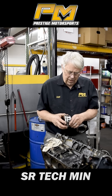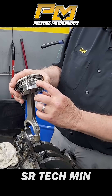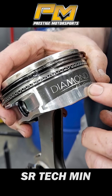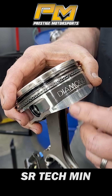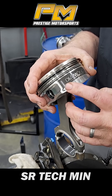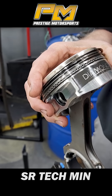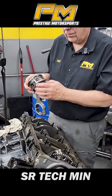I just wanted to point out, as I'm tearing it down, you can see this scuffing here — pretty severe just for dyno time. You can see it's an OEM block, a lot of stroke, short compression height, so the piston's going to come out of the hole, which is kind of normal. But this is pretty severe. What this is from is really not a correct prep job on the bore before it goes into final assembly.